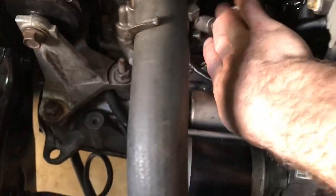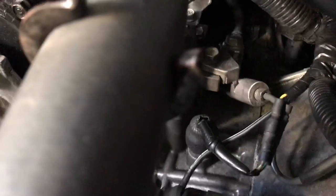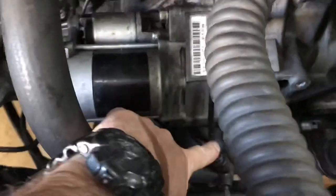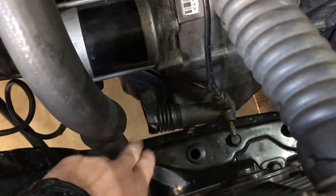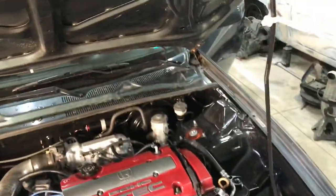All of this connects — there's a steel hydraulic line that goes underneath the back of the engine, and over on top of your transmission there's a banjo bolt set up right there. You can see that banjo bolt just back there, and then it gets into this manifold, and then this line goes to your clutch slave cylinder. My clutch slave cylinder is not leaking, it's actuating, so I'm almost positive it's not that — it's got to be the clutch master cylinder, so we're gonna replace it.